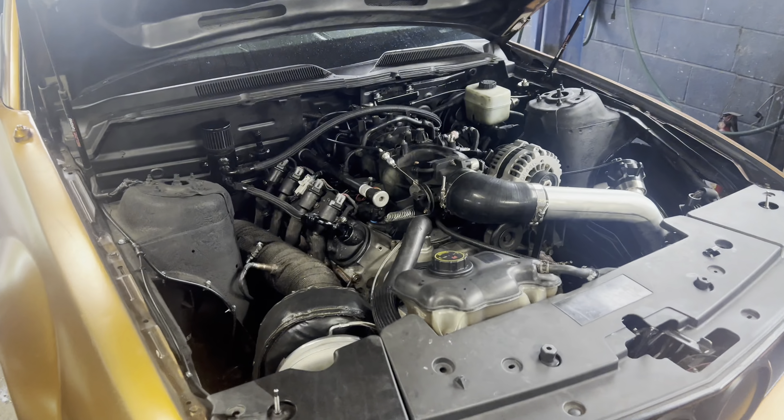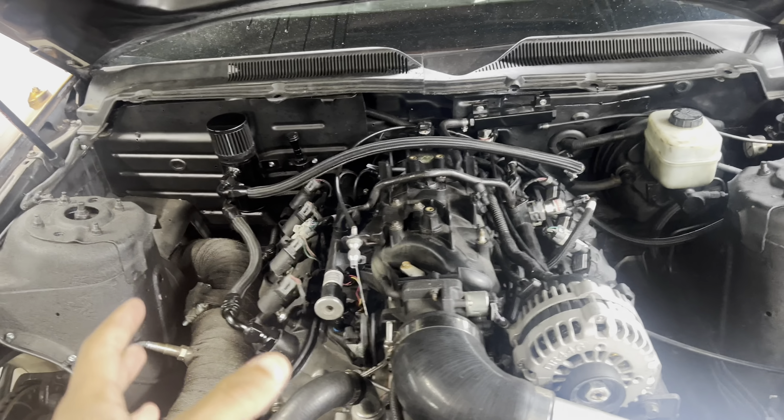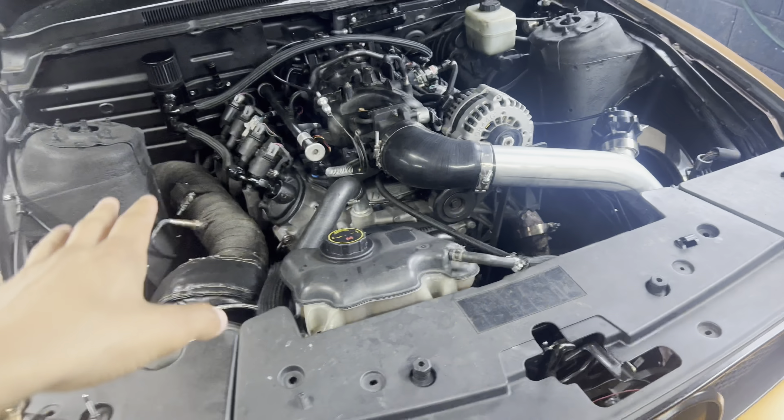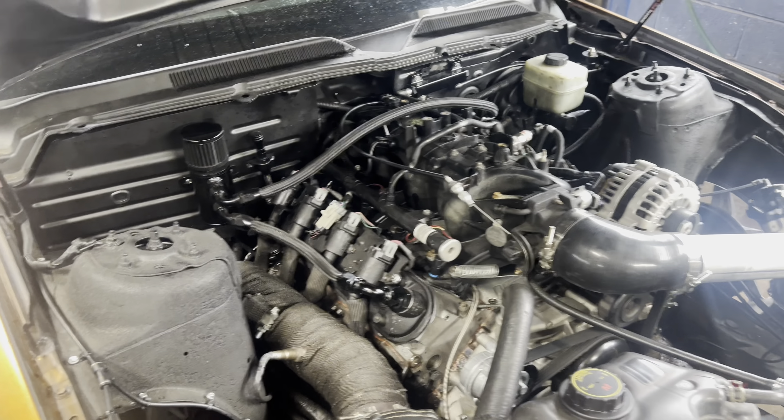It's been a little while since the last clip. The car is happy — the engine has about 150 PSI of compression on all cylinders. It's not pressurizing the cooling system anymore, and it doesn't even get up to 180 even when you put it on the brake two or three times. No problem now.